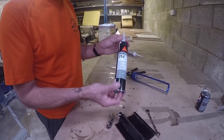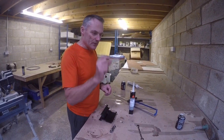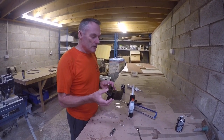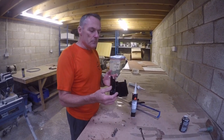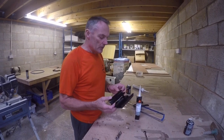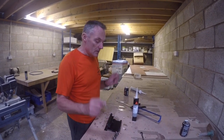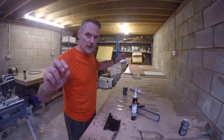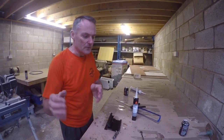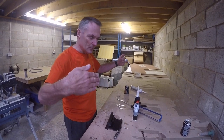In our case we're using black of course. Now with the Citroen Relay, because the three fixing points are simply just three nubs that stick out of the roof of the van, it would be very easy to just go up there nonchalantly, bolt these on, and then ultimately realise that they're out of alignment, they're not level, etc. So what we're going to do first of all is attach them to the roof and using a builder's line ensure that they're all in perfect alignment and perfectly level in relation to each other — starting at the rear because that's the easiest one to fit, then the front, and then lining up the middle one to conform to the two that are at the extremities.